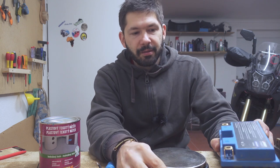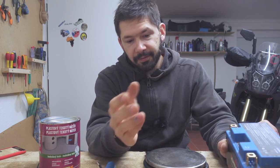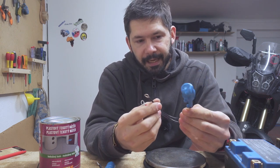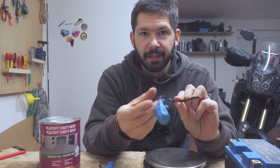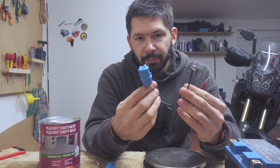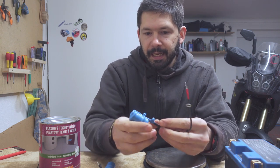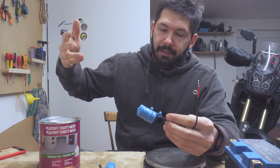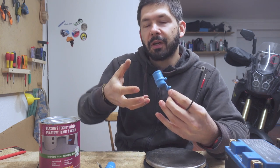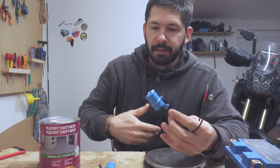So for situations where you would not have any juice, or if the internal fuse goes off, the capacitor should save the day — because this is actually like a tiny battery. The theory is you plug it in instead of the battery, not together with the battery but instead of it. Then you push-start the bike, the alternator creates power, the power goes into the capacitor, the capacitor holds it long enough for the electrical system to start up, and then you just roll and the bike can be push-started.